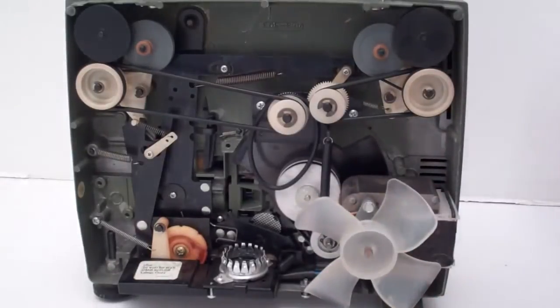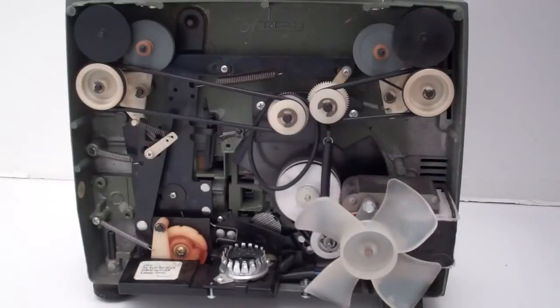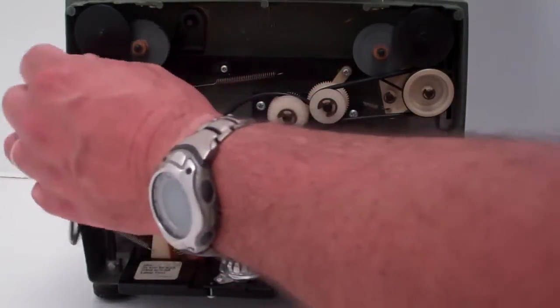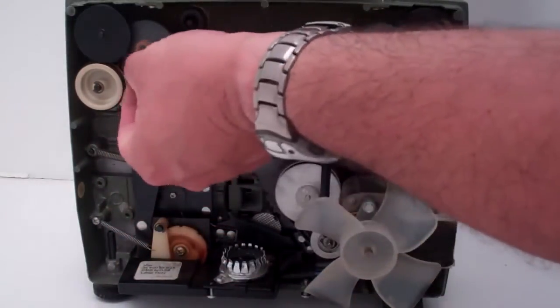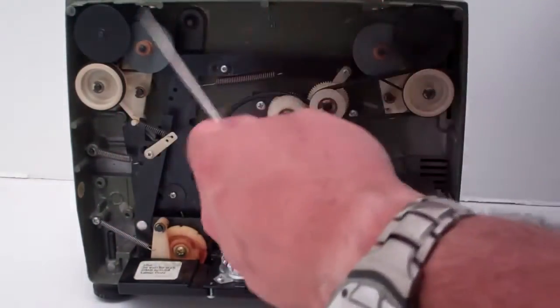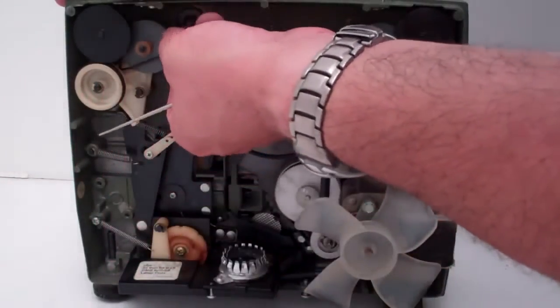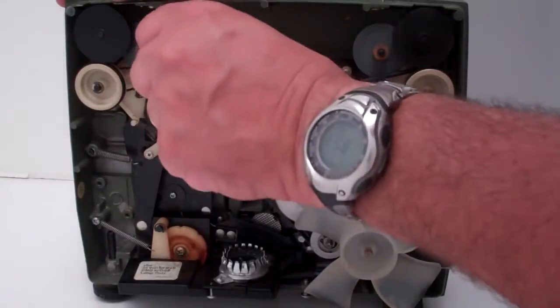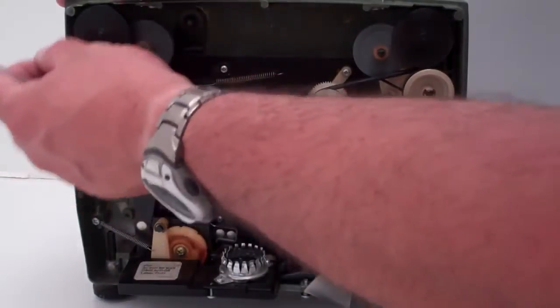Okay, now we're going to start on the other belts. Don't take anything off, basically, until you're ready to replace it. We're going to take off the longest belt in the kit. It just snaps out. Then this belt has a little one back here. And as you take it off, pay attention. It's got a twist. See, this is going to have a right twist. Well, actually, I guess when you put it on, it'll be a left twist putting it back.